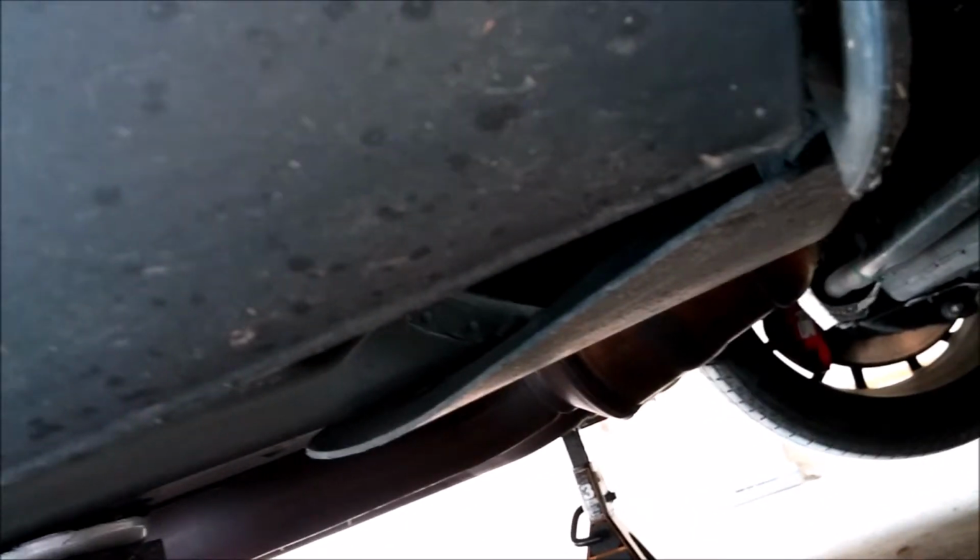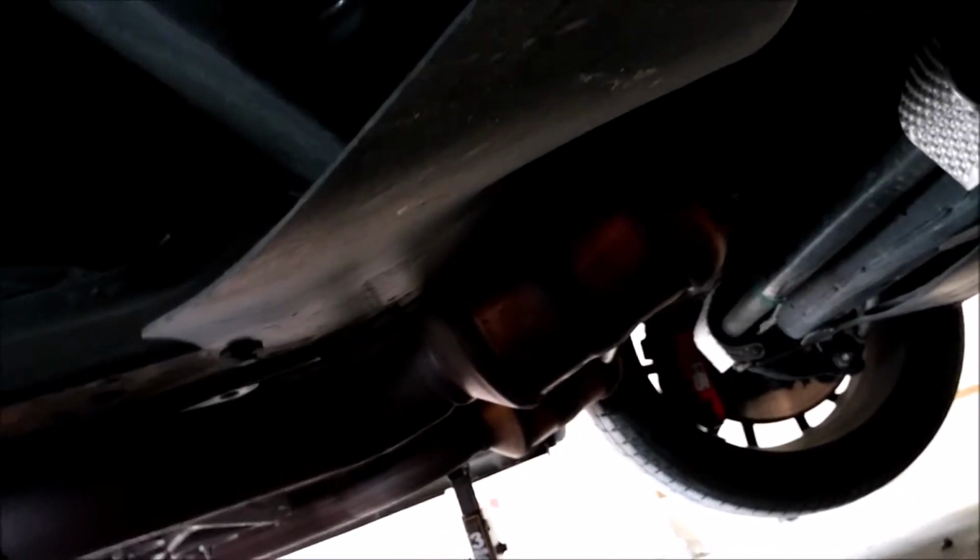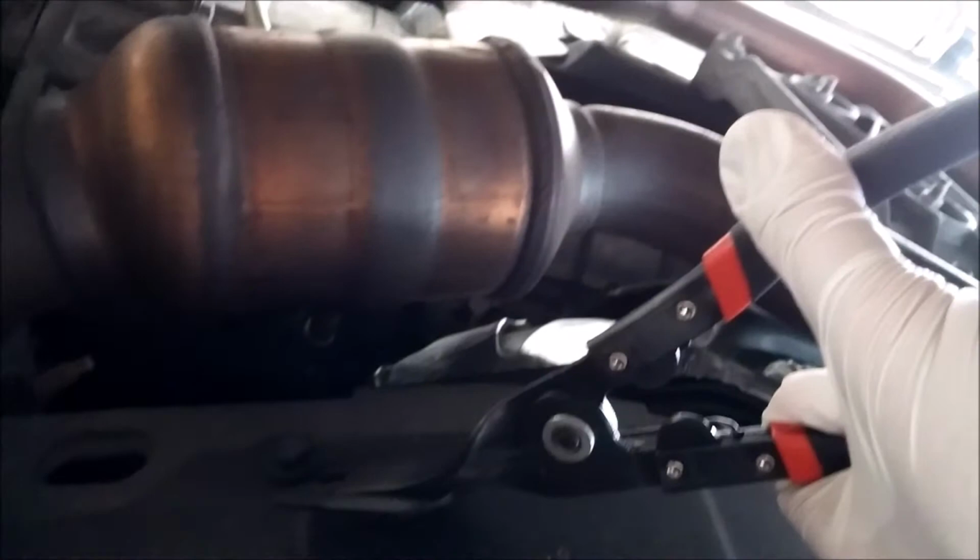Alright, going on this other side, I've got the jack stand on the first side. If you want to remove the trim clips, there's one here, one in the wheel well, another one in the wheel well, a third one in the wheel well, and one more up here. It's really hard to see, but basically anywhere you see something that looks like this, just follow this trim piece and take them all out, and then you can remove the whole trim piece like I did over there.